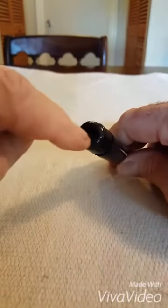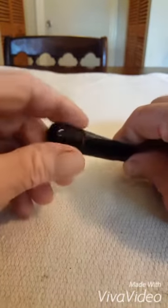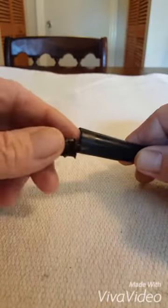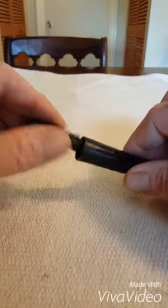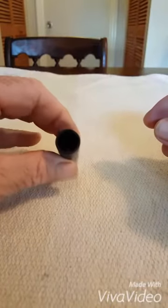The steam goes out your stainless tube, down this hole. Too much air comes through these notches and down the groove. The way to fix that and make a manual wand out of it is to block the groove that's in the end of your steam tube.